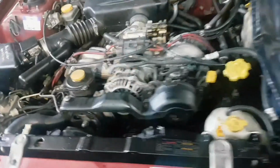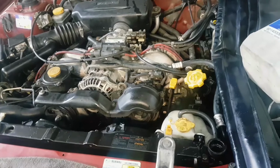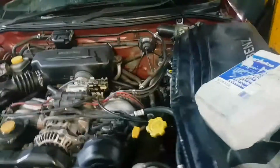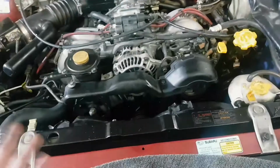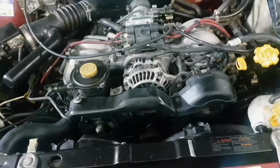Regardless of what methods you use and how you do it, be very, very patient with these cars. Be very cautious. Don't overrun them without filling very slowly an amount of coolant. If you put 2.5 litres in, you're making a mistake, okay? Especially with the job I've done, if you refer to the previous videos, the timing belt and all that. So here we go.